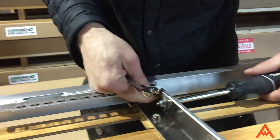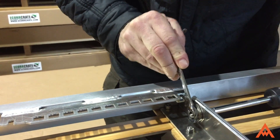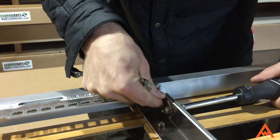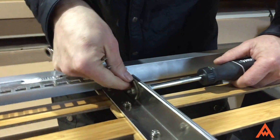With the 7/16 wrench and a 3/16 Allen, you will start tightening it. The spring steel allows it to build tension before it gets all the way tight. I like to actually run these a little bit tight, so I pinch them kind of tightly shut — fine tune it a little bit.